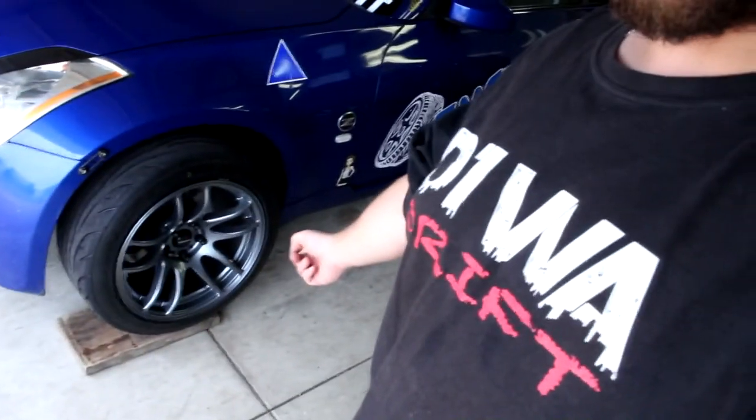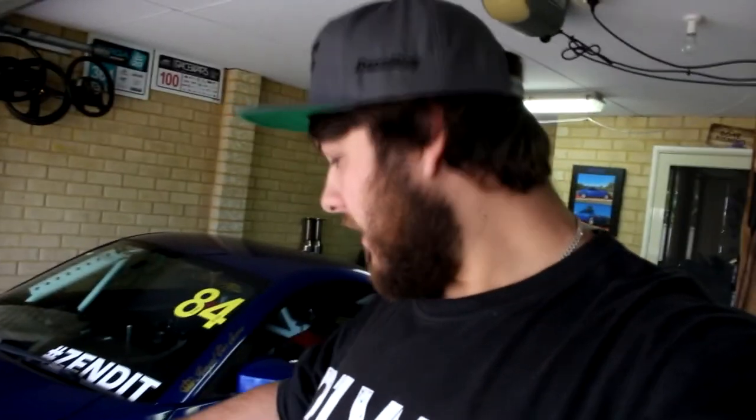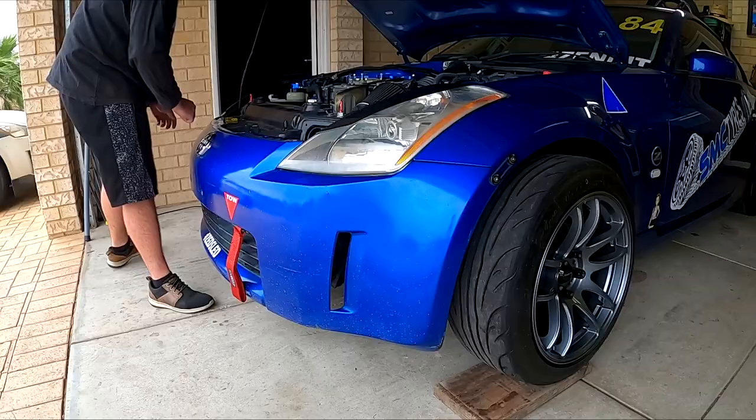So first things first, I've got it up on the wood blocks, and what I'm going to do is start installing the front bumper. While I've got the front bumper off, I'm going to jack the car up, undo the front wheels so I can get the inner wheel well out, that plastic part out, so when it comes to installing the fenders, it's just straight into the fenders, don't have to worry about jacking it up and doing that. So